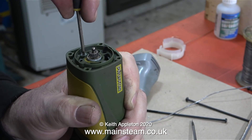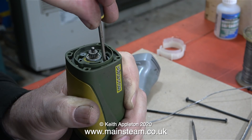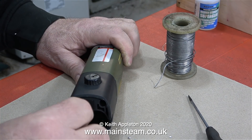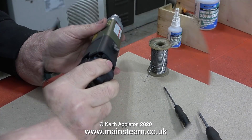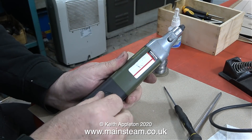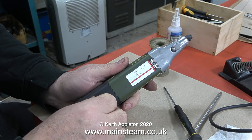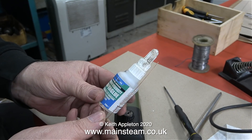In this clip I'm re-tightening the bolts that hold the motor in place, but I made a mistake — I got the sequence wrong. On the bench you can see a white plastic piece that has to go around the motor first, so I undid the motor and refitted it. Then I replaced all of the long bolts using the special Torx screwdriver. Time to replace the battery and see if it works. The noise you can hear when the drill stops is my dehumidifier that I use in winter in the workshop.